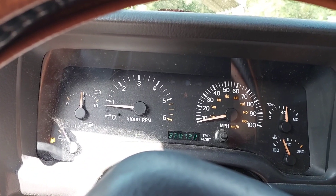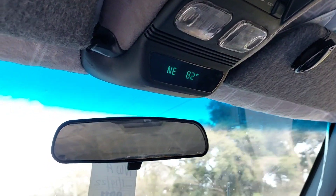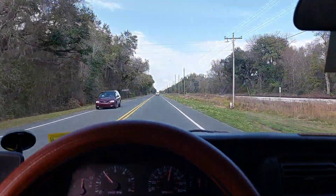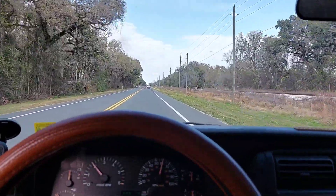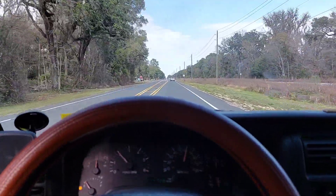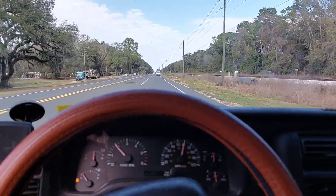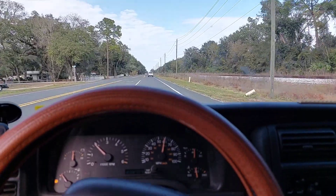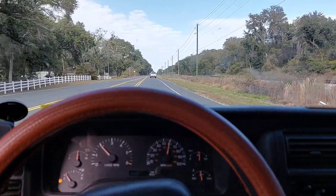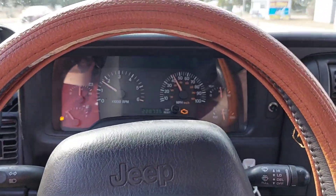After a few minutes the engine is running well, time for a test drive. It's 82 degrees in Florida — quite a contrast to snowing in Wisconsin. After putting in those new spark plugs, the engine seems to have a little more power. The spark plugs didn't strictly need replacement since the service interval hadn't been hit and they still looked fine, but they're cheap so it's worth doing.